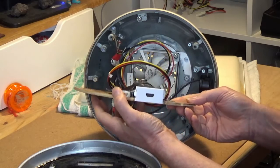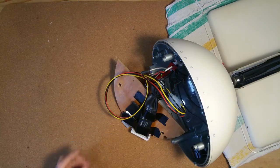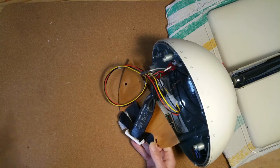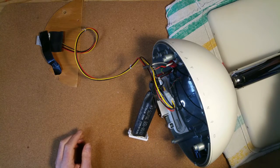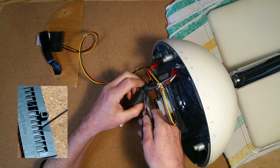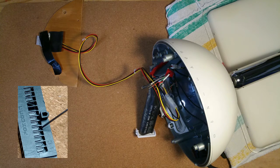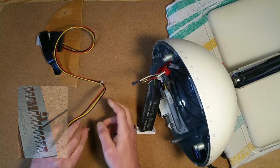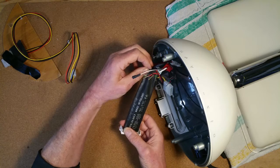With everything else stripped out you need to identify two cables: the LCD video cable and the one marked inverter. The LCD cable carries the signals to the LCD panel and the inverter carries the power. The LCD cable has a proprietary plug which attaches to the motherboard. Don't cut this plug off — instead pry it apart carefully with a small screwdriver to free the inner plastic part, then peel back each of the plastic tabs using a safety pin. Press down on each of the brass pins behind these tabs to carefully pull out the wires intact. Repeat this process with the inverter cable.